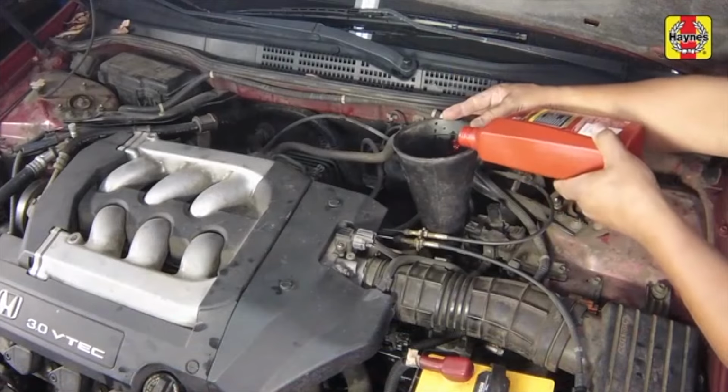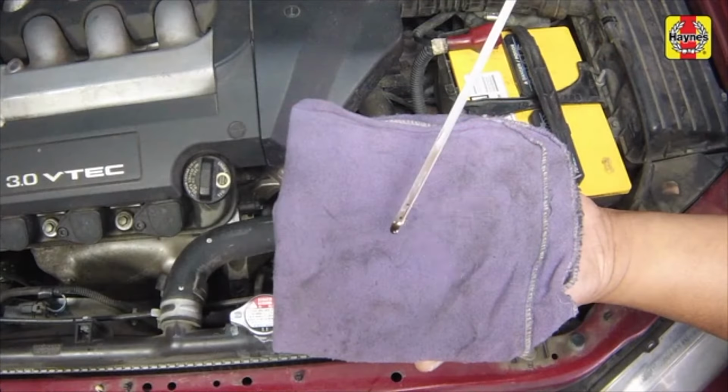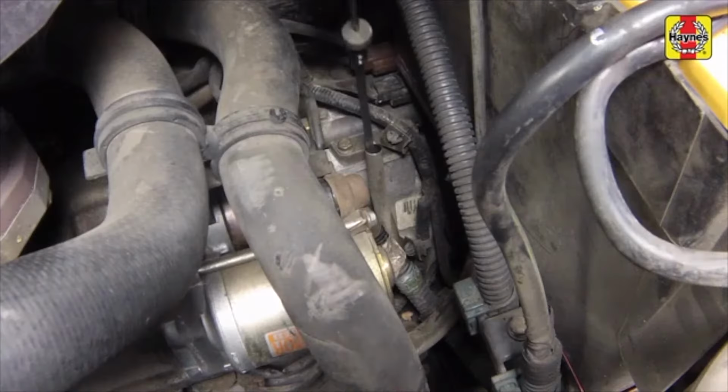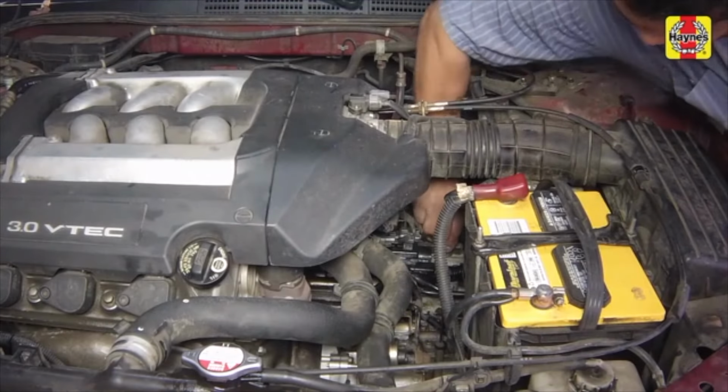Remove the filler bolt and add fluid to bring it into the area between the two notches on the dipstick. Be sure to cycle the transaxle through each gear range, ending in park, as described previously, between additions. Install the dipstick and ATF filler bolt, tightening it securely.